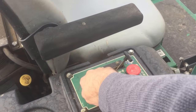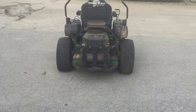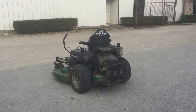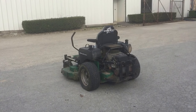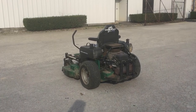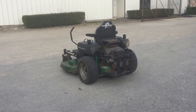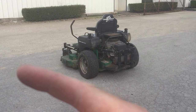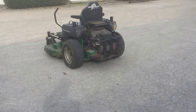I'm going to start it up and we're going to do a little test on it. So the engine is obviously running — it appears to be running fairly okay. But I know if I try to put any kind of load on it, it's going to bog it down. And if I try to drive it with the blades on, it's definitely going to bog it way down. So what I'm going to do here is pull off one spark plug wire at a time and see if the cylinder on the opposite side is good. Because if I pull off the spark plug wire on this side and it stays on, that means the other side cylinder is still firing. So let's go ahead and try that.